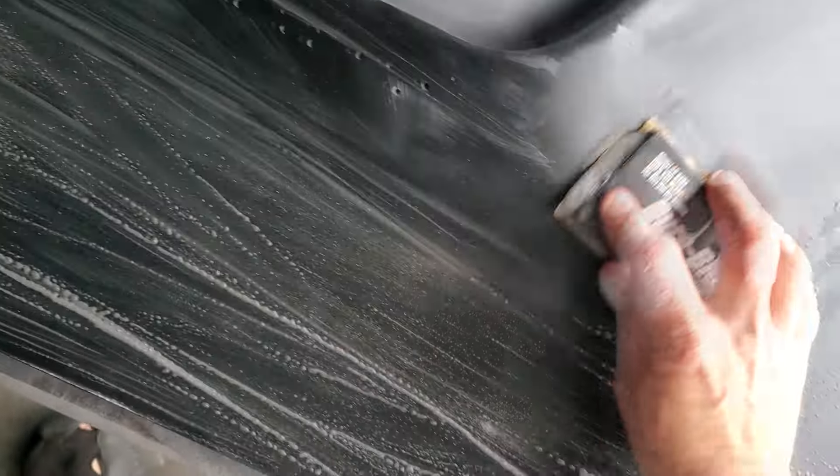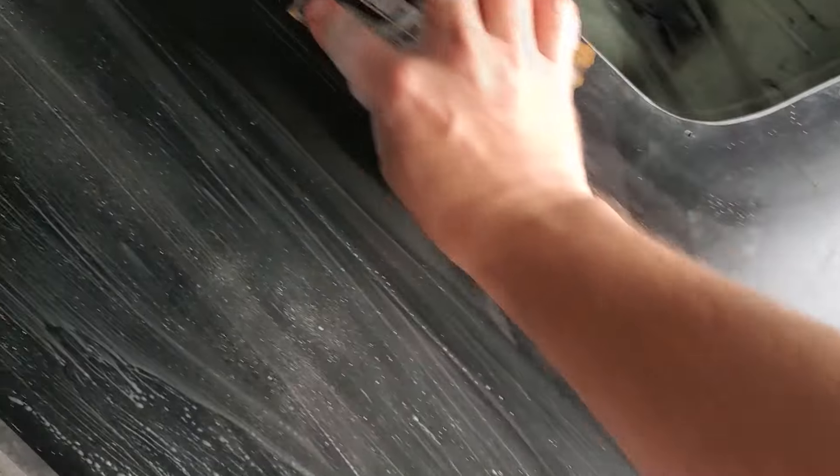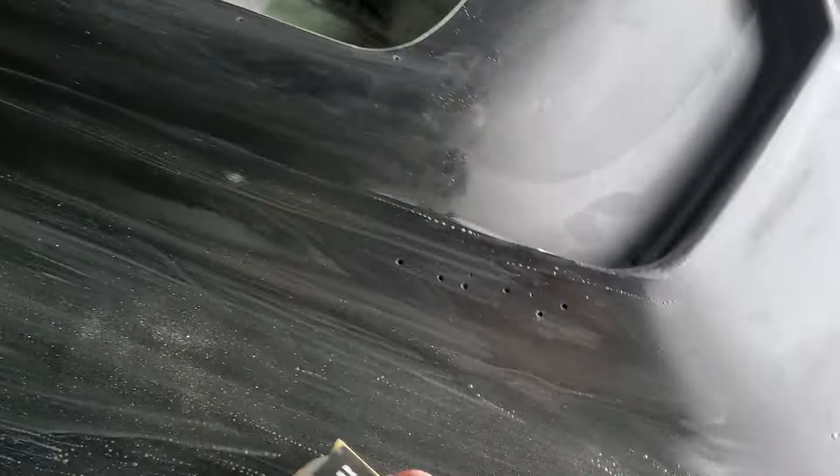So now redoing the hood — you can see how it's quiet when sanding and then gets a little bit louder, and you can also feel it too. I'm using 400 grit right now. This is still the primer. Before I put down the paint I want to go down to 800 grit, since this is the outside — what you're going to see — so we want this to be as perfect as possible. The inside is just temporary work. Once it's painted I'll let it harden for about three weeks, then flip it over and do the back side again. I just wanted to get the back side close enough.